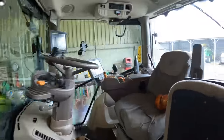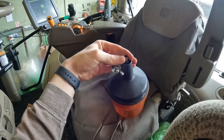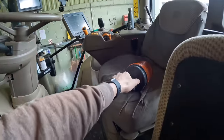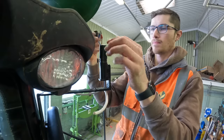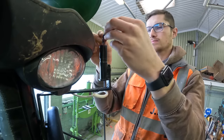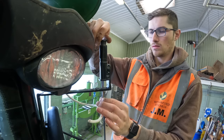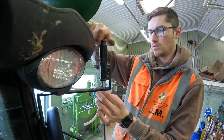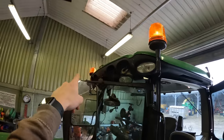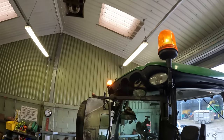Brown is live, so that goes on the bottom of the beacon — to this leg here that's got the little coating behind it, which makes sense for it to be protected. This one has a big crack in it and the bit of plastic doesn't sit on top of there very tight, so I'll get a new one. We are working! Now obviously they're different beacons so that one looks a lot better, but I'll just buy a couple of new ones that are the same and at least they'll match. But it's working.